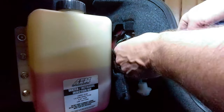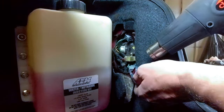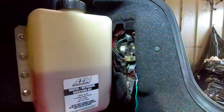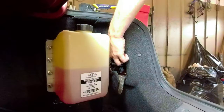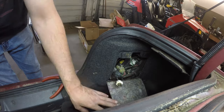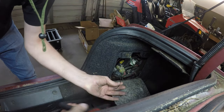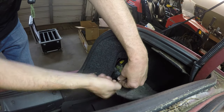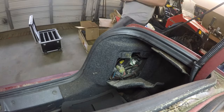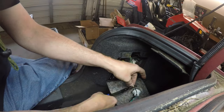The 1156 bulb sockets are really easy to figure out with only 2 wires. You know, put the black ones together. They go together. The 1157 sockets have 2 positive leads and 1 negative lead because they have dual filament bulbs. The black ground wires still go together on those too, but there's 2 positive circuits on that kind. If you're replacing that one, turn off your autopilot. You need to pay a little bit more attention to their orientation because the brake lights and the corner lights will be out of phase if you get it wrong, and that'll be weird. That's a stupid problem to have.